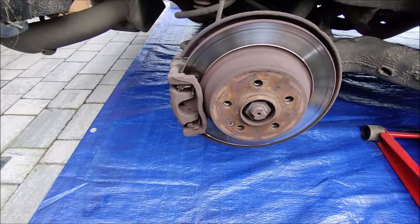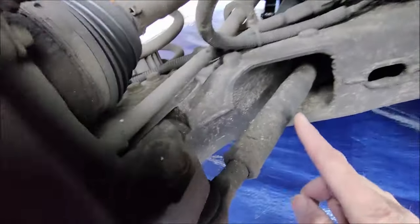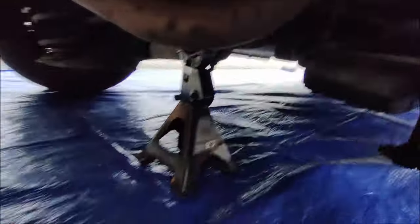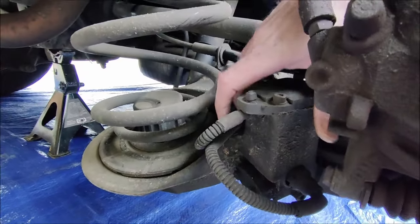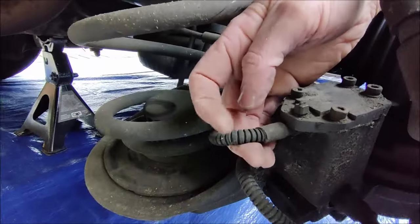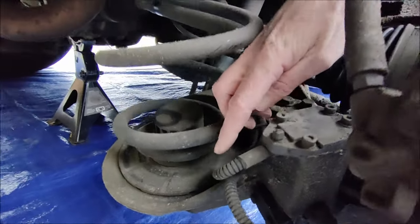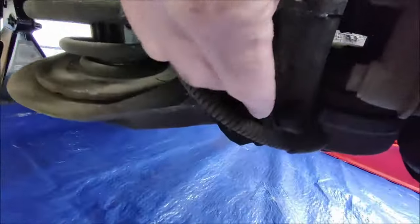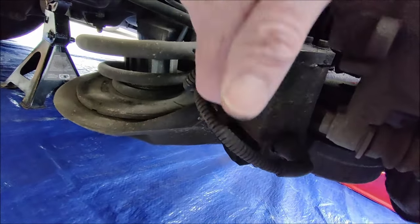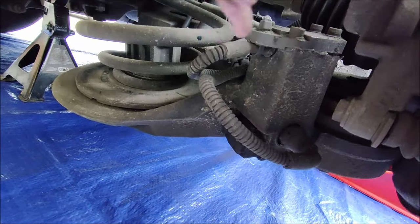Here we are at the hub — we've taken the wheel off. This hub is pivoted down low. We have a rod here linked to the actuator. At the back we have this box formation — inside is the solenoid and the lock pin. There's a cable there that supplies 12 volts to the solenoid. On the side of the box there is a switch that tells the onboard computer whether the locking pin has been pulled in or out of place by the solenoid.